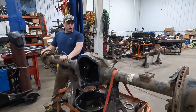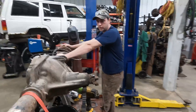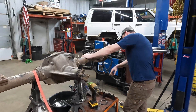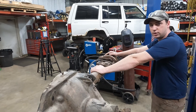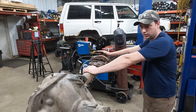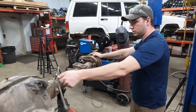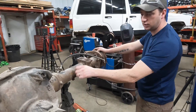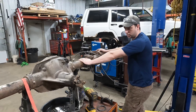Hey Travis, what are you working on? We are starting to prep the rear axle for the XJ project right now. We're just gutting it. We've got the diff out — that's gonna get rebuilt, re-geared. I'm not sure what they're gearing it to just yet. Got the axles out. Trying to get our hub ends off, and then we got to do some cutting — get our leaf spring mounts cut off, get these little nuts cut off, get the tube cleaned up so we can get the truss ready to go on.